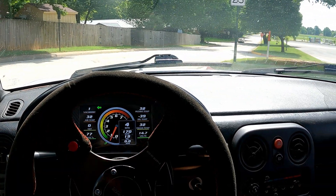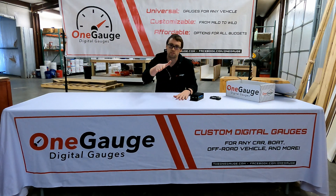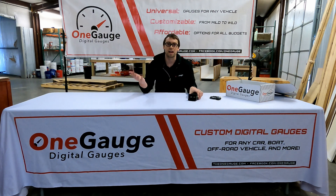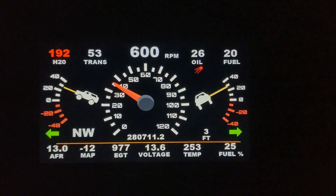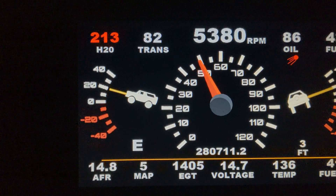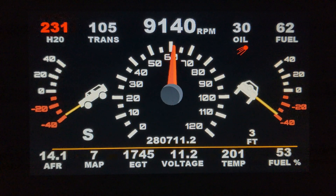The next thing I want to talk about is our accelerometer feature. The accelerometer offers the ability to measure vehicle roll and tilt, so as the vehicle tilts to one side or the other or goes up or down an incline, it also offers the ability to do g-force readings. All of these things can be configured based on the way that you mount the hub in the vehicle — you can change the axes that are measured on the screen, and we have all of that detailed in our installation instructions. The accelerometer is a great feature especially if you're racing or off-roading.